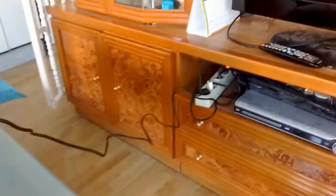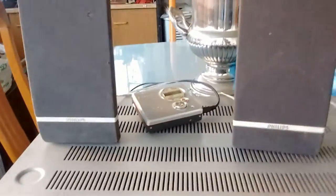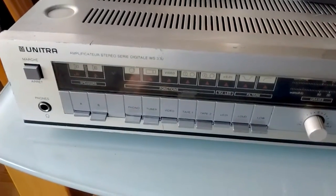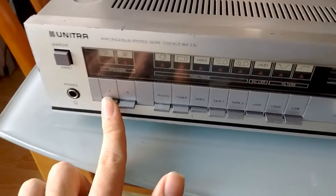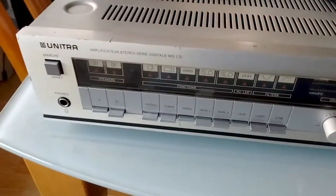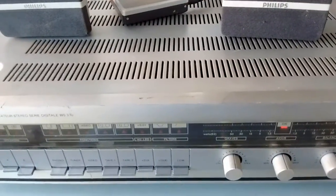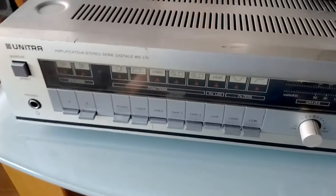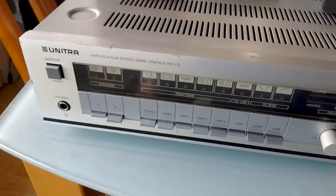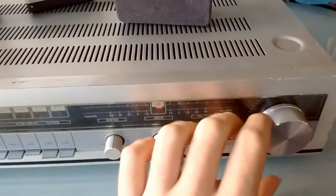While my phone was copying files to my server I went ahead and plugged the amplifier in and hooked it up to my minidisc player onto a pair of little tiny speakers. And what do you know, it works — exactly like the description said: only the A group of speakers work. The B group has no sound whatsoever. Also the left channel sounds a little bit louder than the right channel — I'll have to adjust something inside. I'm hoping the B group is just a fuse problem or something.